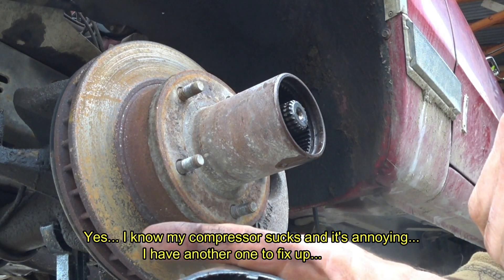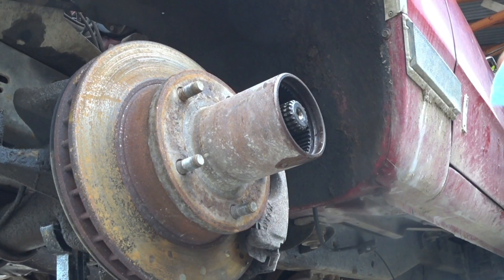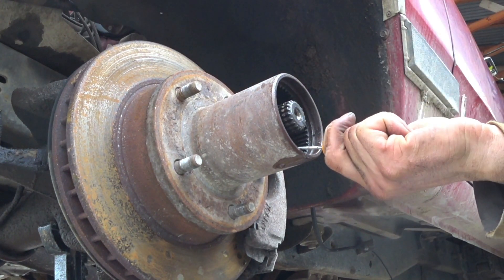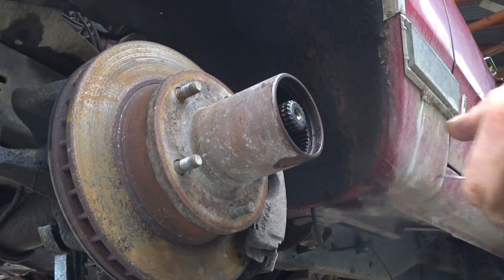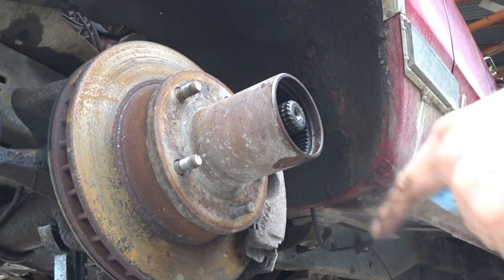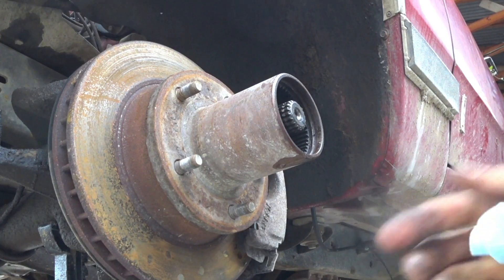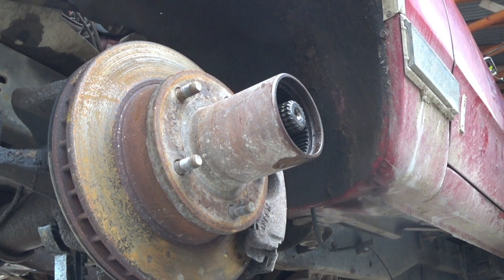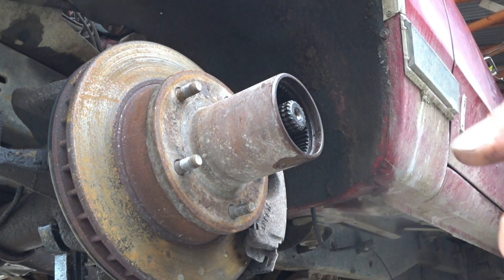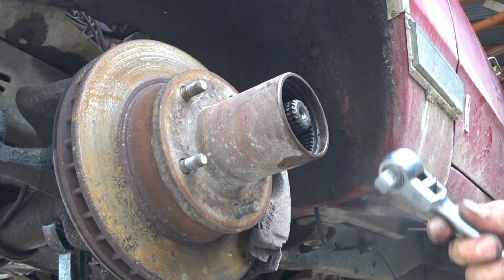That's not for impact use — it messes the tool up a bit when you do that. Take this lock nut off the spindle. The next thing to come out is another little funky piece — it's a lock for the adjustment. Now this has a key on it, so it only goes on one way and it locks onto a pin, so when you tighten this you've got to line it up with that pin. And then there's one more adjustment nut. It uses the same tool but this time I ought to be able to use just a regular half-inch wrench to get it out.